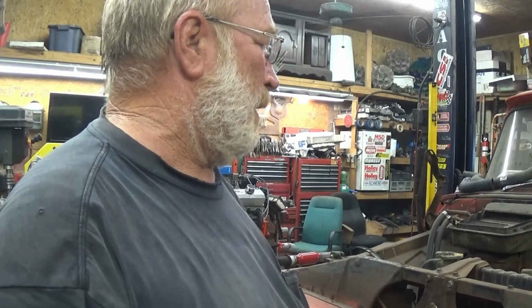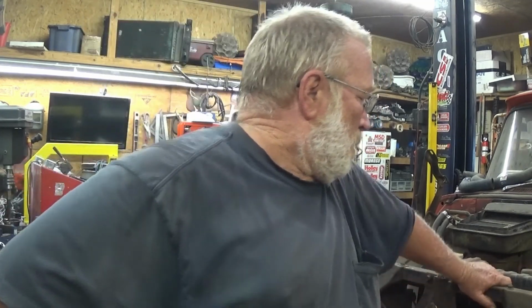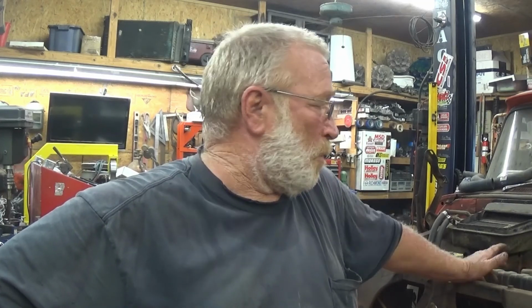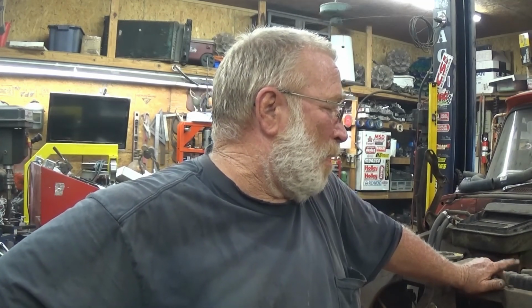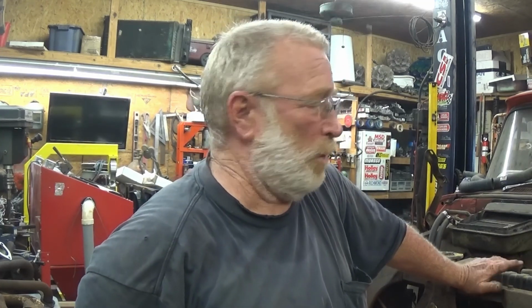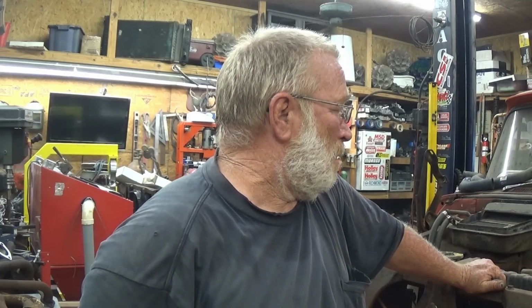I've got to pull the carburetor off this thing and go back through it. Evidently something's sticking. It sets for a week or so, let's say a couple of days, and it won't start. Crank, it won't even try to hit. Squirt some gas in the carburetor, it'll bust right off and sit there and run great. From that point on, starting it off and on all day, it does fine. Let it sit for a day or so, same thing again. So I'm thinking a little needle, check ball is sticking in the carburetor. I'm not sure, but I'm thinking that's what it is. Either the accelerator pump is no good, or that little ball's sticking. But we'll get it off, get it apart, and see what's going on. But that's what we've got done.